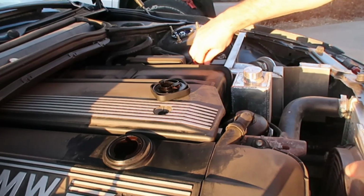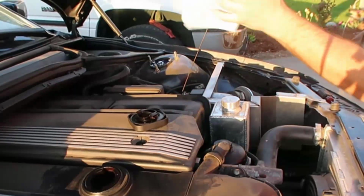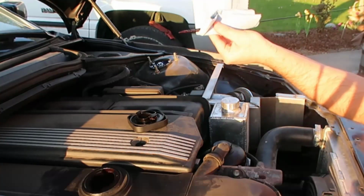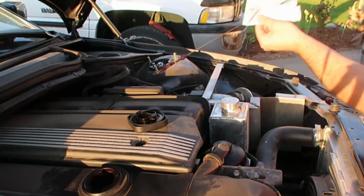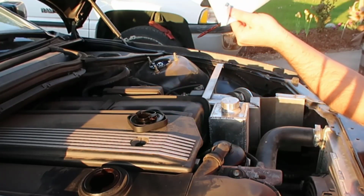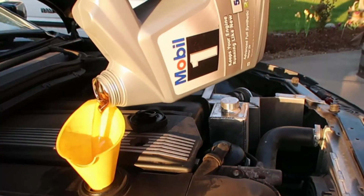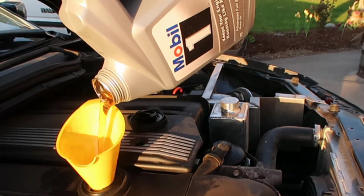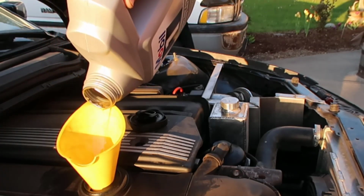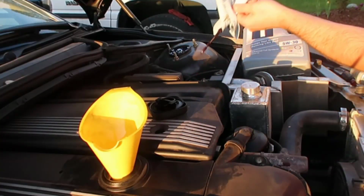And so you put some oil, and dip the dipstick, take it out, clean that. It's kind of tricky, but you can see, right, it's not shiny. Now you put it back in there and take it out. Do you see that's shiny? Just the end of it. So probably because of the filter I need to put 5 or 6 quarts. I'm going to try. So this is 5 quarts. Oh no, no, no, don't fall in there. Put 5, a little less than 5.5.